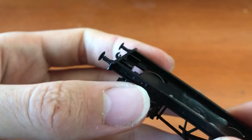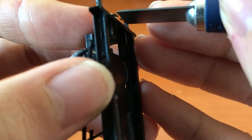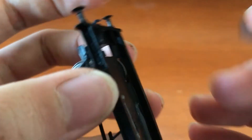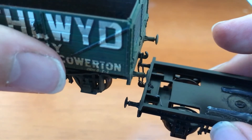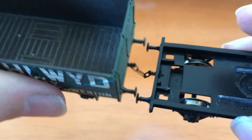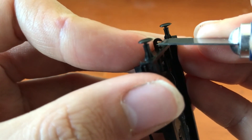The reason you take the body off is just so it's a lot easier to get in with the tool — with something like this one you might get away without taking the body off, but generally speaking it makes it a lot easier. I've got the flat chisel blade. Just keep going, smidging a bit off the back like that, until a chain link goes on and off pretty easily. Also check that from most angles the chain won't get stuck. Flip it over and do the same thing on the other end.